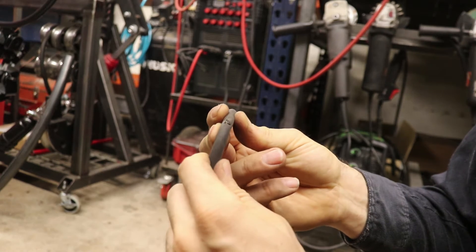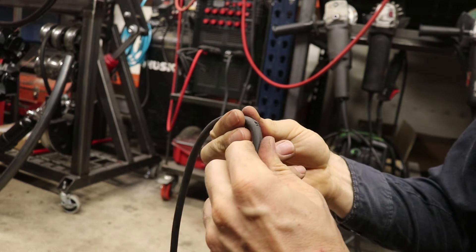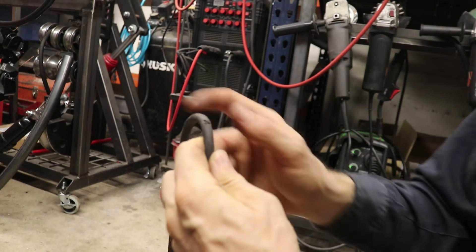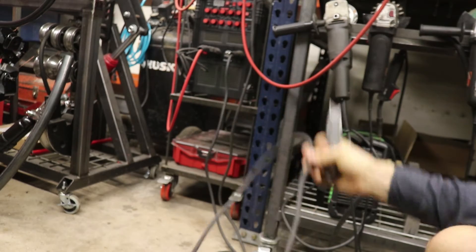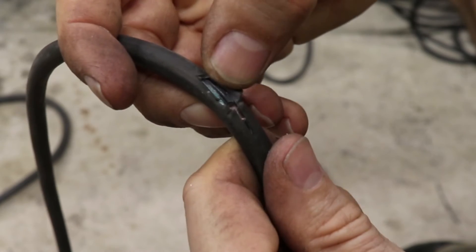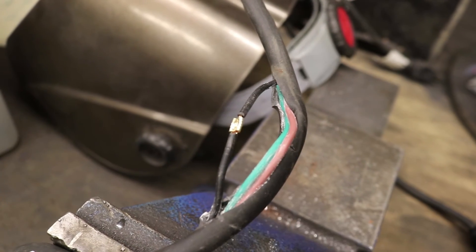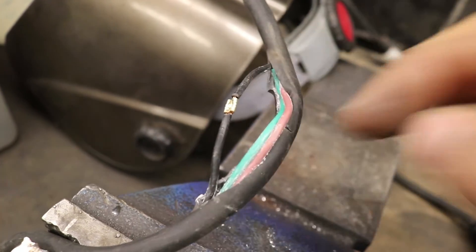I am super stoked about saving some money. Clearly at some point I nicked this with a grinder or something. Maybe dragging this on the floor — it's close to the pedal, so maybe it got caught on something and just ripped right through. Sure enough, it is indeed the black wire that is cut. All right, I've made my repair. Now we're going to close everything up, put some tape around this, and then tape the whole thing.